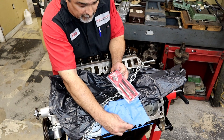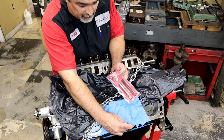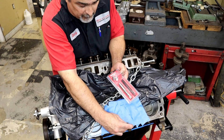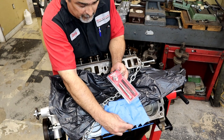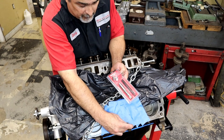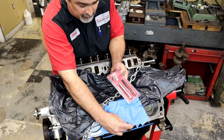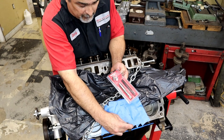That's actually why we're here, and now we're done. Simple, quick helicoil. Now you know what a helicoil is — it's literally a coil that's put in. I've shown you how to put it in; they're real simple. The tips that I think are going to save you: it needs to go in straight and you need the right drill bit. Alright, I think we're done with this quick little video. I'll see you on the next one.